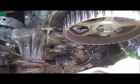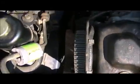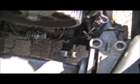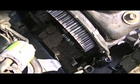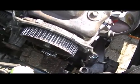There we have it, lakes. There was a squeal developing somewhere from the engine, this side of the engine, and I could not locate it. So I started to rub all the pulleys and whatever that rolls, and it seemed to me that the pulley you see down there, which is a tensioner pulley for the power steering belt, sorry, was most likely the culprit because of the draft. Well, I replaced it, and I got a very worn tensioner out. So it was a very good thing to replace it, but it did not solve the problem. The squeal was still there.